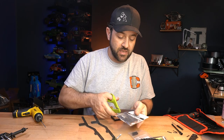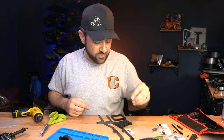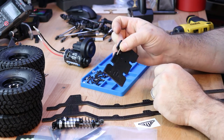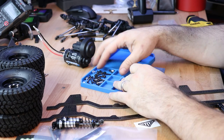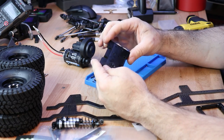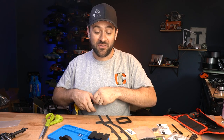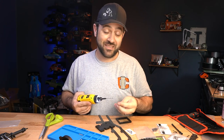Let's get the skid plate installed. We'll put all the new hardware from TGH on the vanquish pit mat and keep it separate to determine if we had to use extra or not. What they may be doing is including set screws that have to go in first through the skid plate to hold the links in, and then a separate screw to attach it — because there isn't any hardware included that is long enough to do both. A power driver is your friend if you're installing one of these.